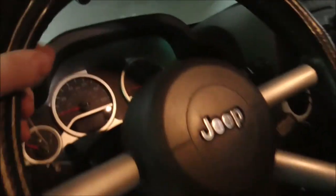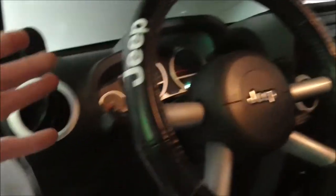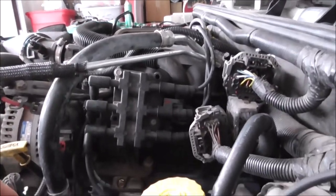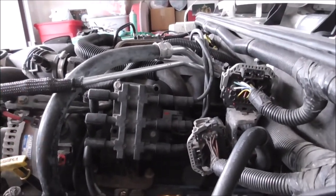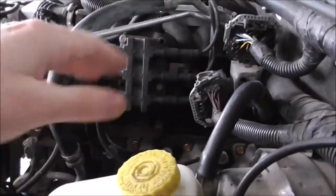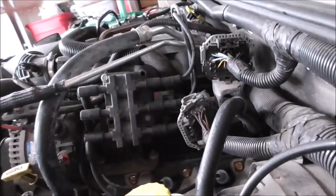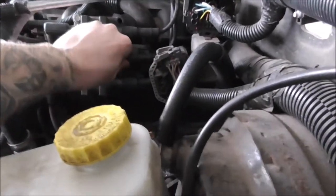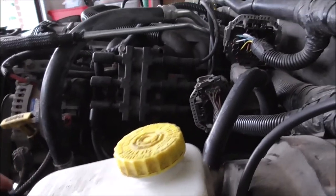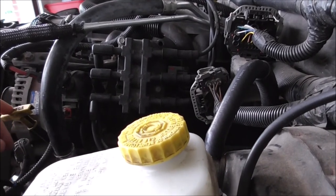I just wanted to show you guys that part of the video so if you have the same problem happen, don't panic. Start with the plug wires first because those are easiest to test. As you can see, I had a defective set. Nothing's perfect, especially working on vehicles — it never goes smooth. But these work. I'm going to reroute them again, put some dielectric grease on the inside, and that'll wrap this up. Glad it worked out — catch you guys next time. Please subscribe and enjoy your day.